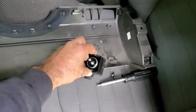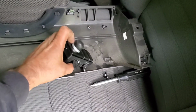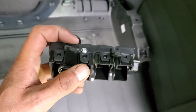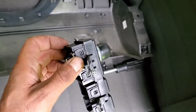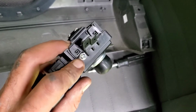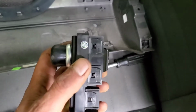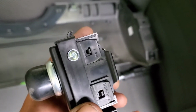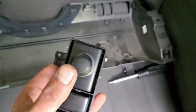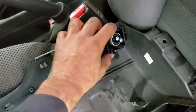In this case, these come out from the back side as such, but if you are installing a push button, it is wise to install some kind of additional fasteners to ensure that this just doesn't push out, because all that holds it in there are these little plastic tabs. And this is another reason why I actually save screws when I'm disassembling printers, computers, power supply units and stuff, because I think those specifically came out of a power supply unit. That'll keep it from pushing out of its holder. And then this will mount back in there.